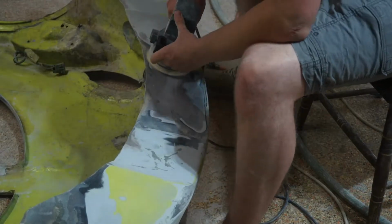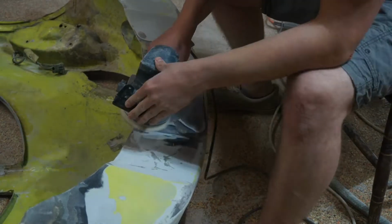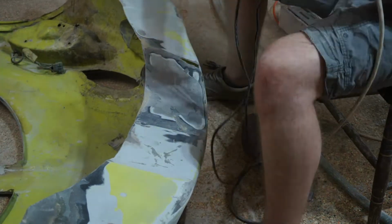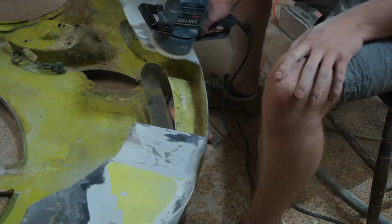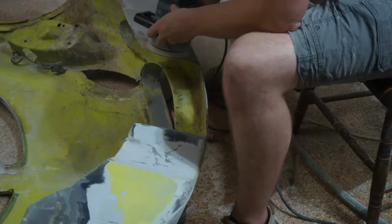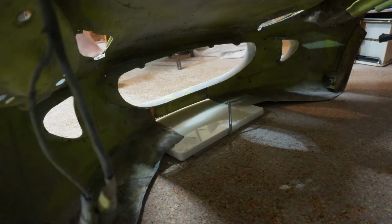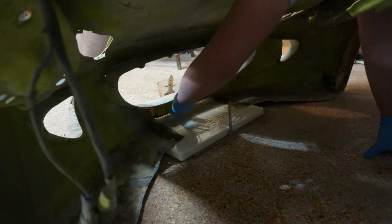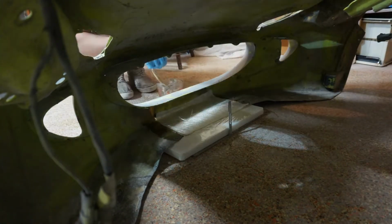Ultimately, I ended up making such a hideous and heavy section at the bottom of the car while trying to reshape it to suit the newly removed license plate holder, to a point where I just decided to cut it out and use a Teflon board as a flat surface to place new joining fiberglass. It ended up being slightly uneven anyway, so I corrected this by adding more fiberglass mat and sanding it down.